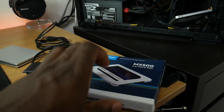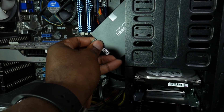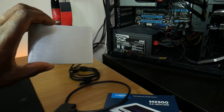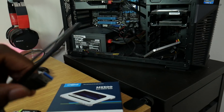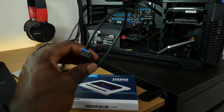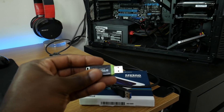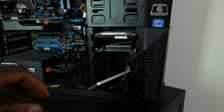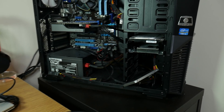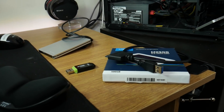This is the new destination drive — a Crucial MX500. The current OS drive is a Samsung 850 EVO. For backup I have two drives: a Toshiba and an internal drive. If you want to make an internal hard drive external, you'd use a SATA data-and-power to USB 3.0 cable. You can also use a USB flash drive for the Clonezilla installation, or put the installation on the destination drive — Clonezilla will load its files to RAM either way.